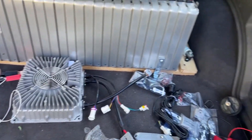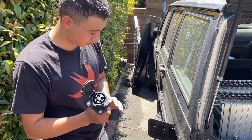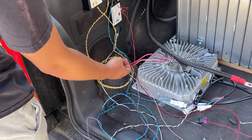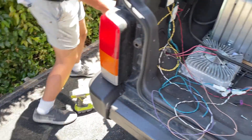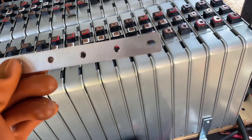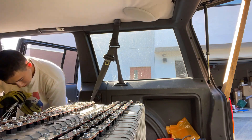Then I endeavored to mount the charging port, which would connect directly to the onboard vehicle charger. We got the charging port right here — it's a Type 1 J1772. We're going to mount this in the gas compartment. The cables from the charging port are wired through a hole here; these are going to connect to the EVCC and the charger. After all that was done, I decided to finally connect the battery pack together using copper bus bars. Along with that, I had to wire each of the 36 connections in the battery management system to a cell on the battery pack.